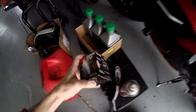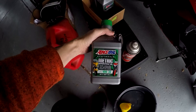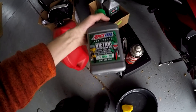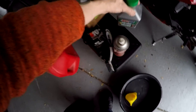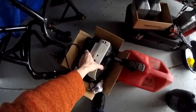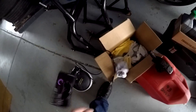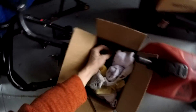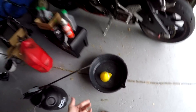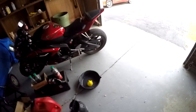I have all my stuff right here. I'm using a K&N 204 filter because this is an '07 R6. I have AMSOIL's metric oil — it's the same thing as their old motorcycle oil, wet clutch safe. The manual recommends 10W30 for the climate I live in. I'll put the fuel treatment in the tank first and pour the gas on top so it mixes well. And I have gloves, old socks and t-shirts for rags, a funnel for filling the crankcase, and a drain pan. I'll use an old gallon milk jug for the used oil to take for recycling.